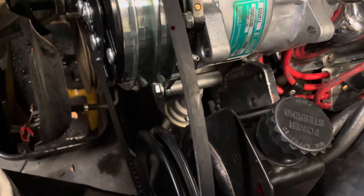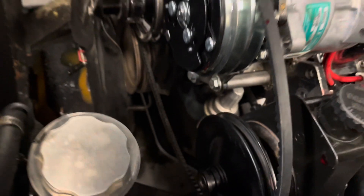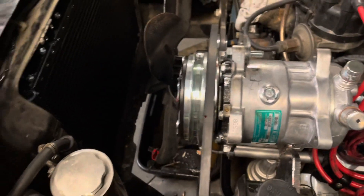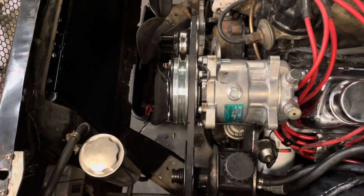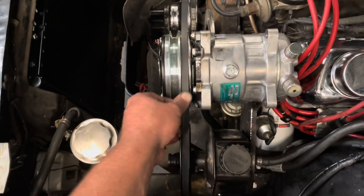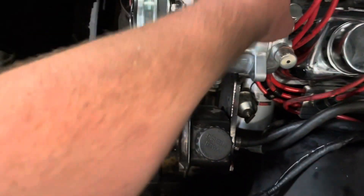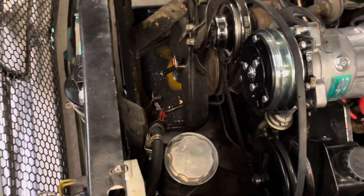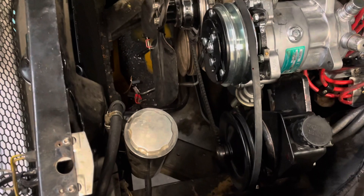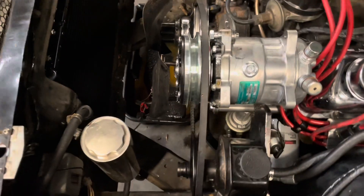That's what I did — chopped that power steering bracket to fit into the compressor bracket, welded it on both sides. Now you can see when I pull this tight — bang, right in line. We'll just have two adjustment points: the power steering pump here and the compressor. That belt's a little short, but I'm going to have to size one up that goes around the crank pulley, over the water pump, over the compressor, and over the power steering pump — they'll all be in line.